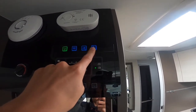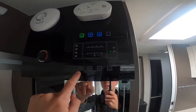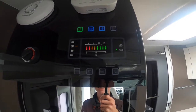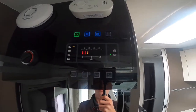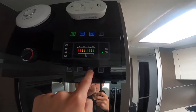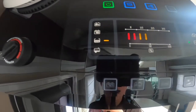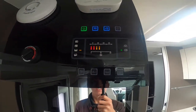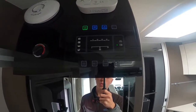You've got your owner light, which is the light on the outside of the vehicle. The buttons on the bottom correspond with displays on the side: the first gives your leisure battery reading — for a true reading take the hookup out and then test it. The next is the Ford engine battery reading. Then you've got fresh water — you can see there we've got half a tank. When that yellow line goes to red it's time to refill, and when the one below goes red it means the waste is full, which you'll need to open from behind the back driver's wheel to release.